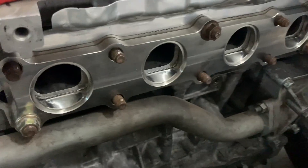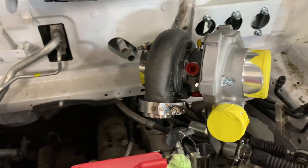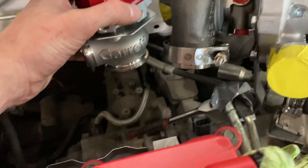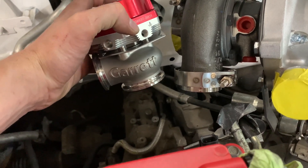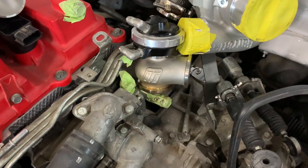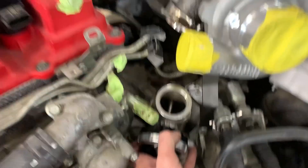Into the turbine side, I'm going to try and keep them all as equal as possible. Another thing to think about when mounting your turbo is to make sure that your wastegate has really good priority. This manifold is going to come up from the bottom and come off at about a 70-degree angle. And as if this wasn't going to be difficult enough, I'm going to be adding a fresh air anti-lag, or a Turbosmart 40mm valve, that'll get placed somewhere down here.